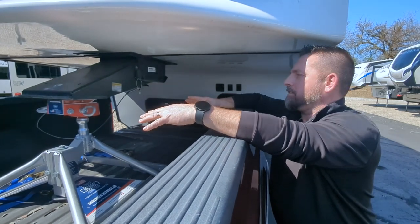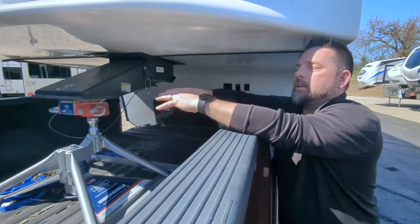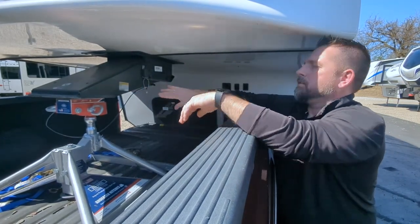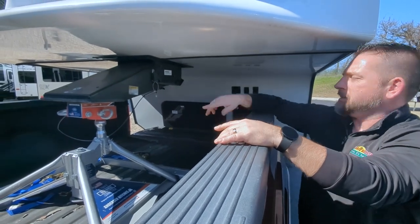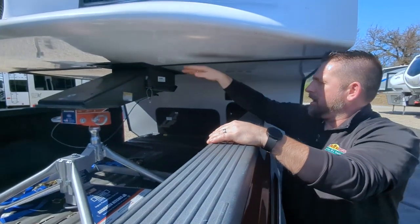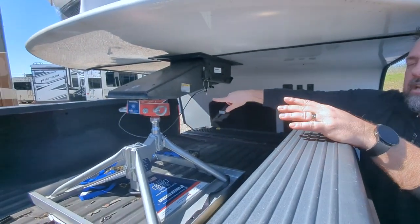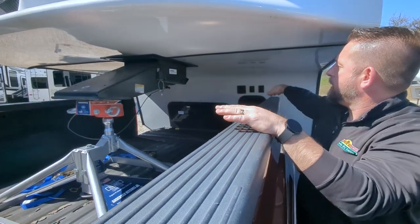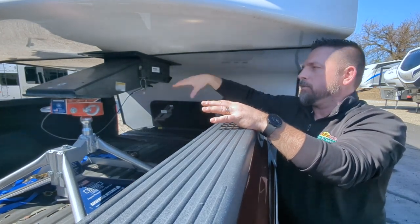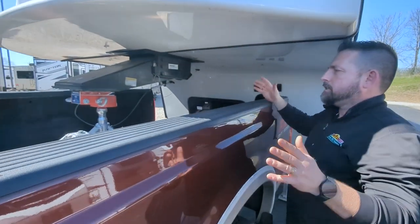The easy thing about these is we have a single point connection with a coupler design that you don't have to be perfectly over. The difference from a traditional fifth wheel is you've got to get that lined up and come down in lock-in position. All we have to do on this is make sure the front end's raised high enough. Tailgate down when we come in — that's a very important step to remember, unless you like buying tailgates. Then we're going to back in underneath until we get the ball pretty much centered as best we can. If you can't get perfect, maybe you had to come in at a slight angle, we should be okay — this thing will come down and follow it because of the way the coupler is designed. Let's just show you how easy the hitching procedure is.